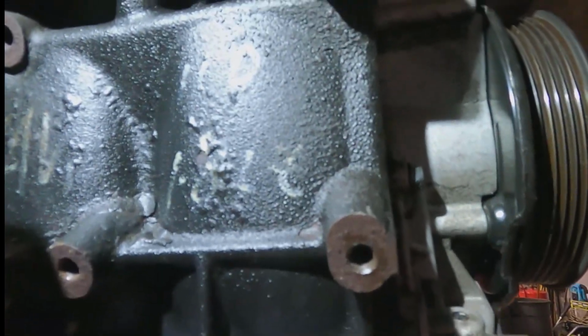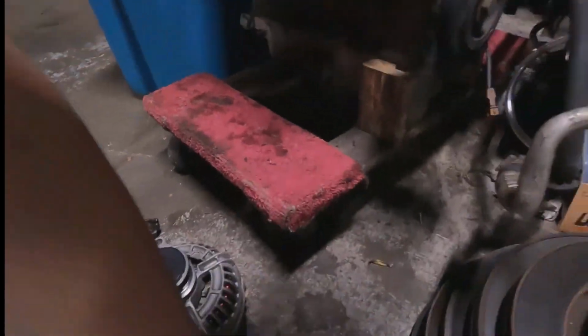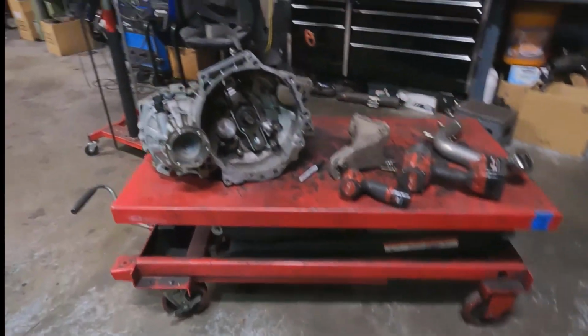Mostly, I'm pretty certain all 4 cylinders have these bosses. You can see there's one right there, one right there, one right there, one right there. So this bracket used to hold the intercooler piping on the Mark IV. It would go right up here behind this 8mm bolt and right here. Obviously now it's in the way, so that's one issue. And then since that's gone, obviously now I gotta figure out a way to route the stock piping.